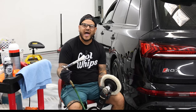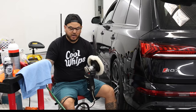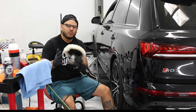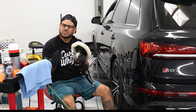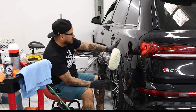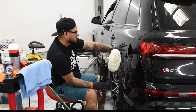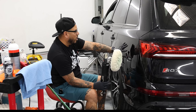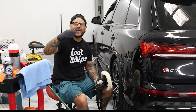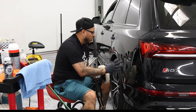Another thing — it's never bad to have a clean pad. I don't even really need to add any more compound because when I polish it, it's already primed. If you feel moisture, you're good. So after you got the scratch out — or you created a divot and sand marks — you're just going to want to make an even pass across your whole path. That's just to make the next step easier, create an even form across the whole thing.